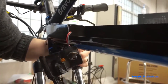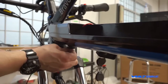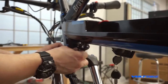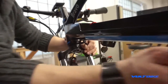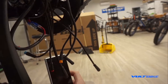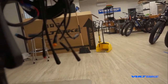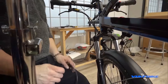If it feels restricted, grab your hydraulic and shift lines and give them a tug from side to side to move them out of the way — you'll notice it frees up more space. Keep pushing until it feels bunged up, then jiggle the cable arrangement again. Just keep going until you see it feed through the bottom. That's the light harness installed with great success.